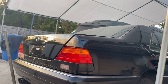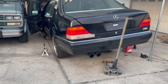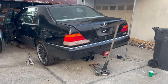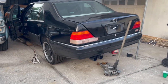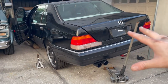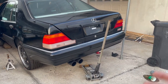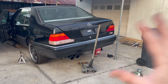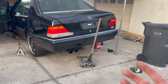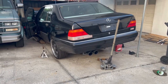Night and day difference guys. The last bunch of times I started this up it would sputter and idle real low - that idle right up sounded real good on startup. That was the issue; it's definitely a fuel issue. I tell a lot of people when these cars sit, make sure you throw in some fuel cleaner in case those injectors get a little clogged, and swap out that fuel filter. This car has been sitting for a while and I guarantee there's some gunk in that tank. It was about a $30 part and took me like five minutes to swap out.